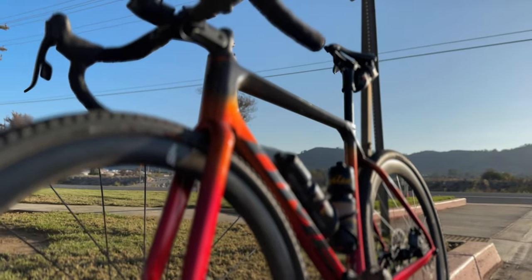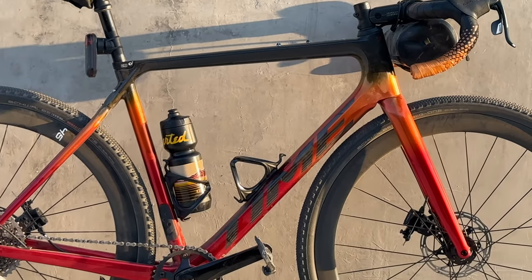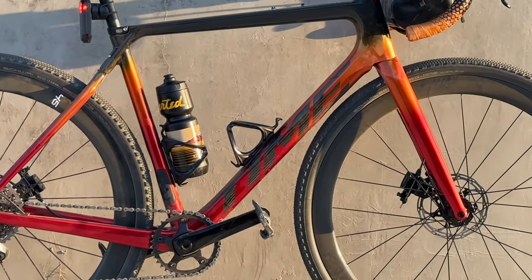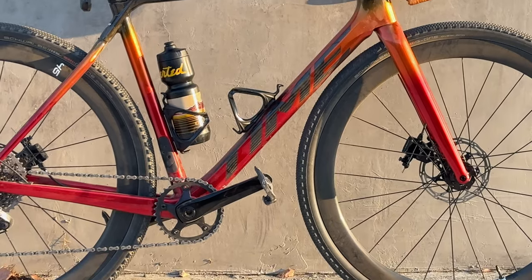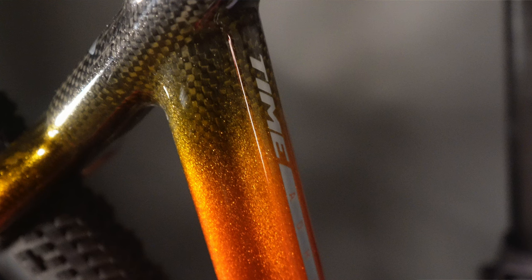Over the standard ADHX, you can also see the same top tube mounting bolts, super clean front derailleur cover system, Kevlar reinforced steerer tube, and carbon forged dropouts. Let's not gloss over those last two features like they're just standard stuff — a strong steerer tube and dropouts that have 20 times the fatigue life of steel are welcome additions to any off-road bike.